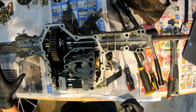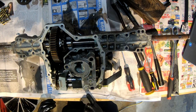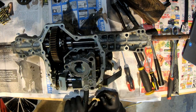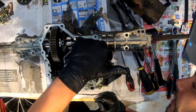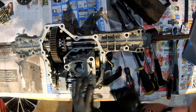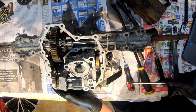I put it gently in the vise by this bracket right here and put a block under this tire to stabilize it, and just gave it a couple little taps, which didn't crack anything. You can see a little marring, but nothing that's going to affect anything. And I got it to come up. It's definitely up about 3/4 inch here and 1/4 inch right here, so right now it's cocked, which is probably why it doesn't want to lift out.